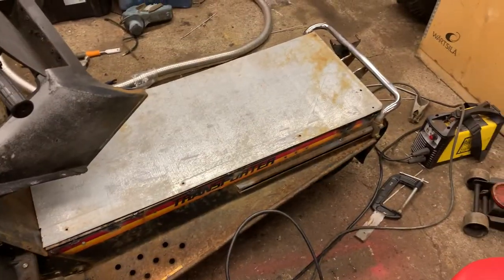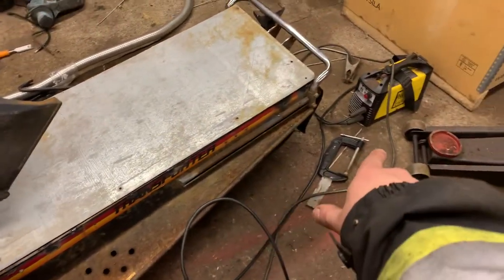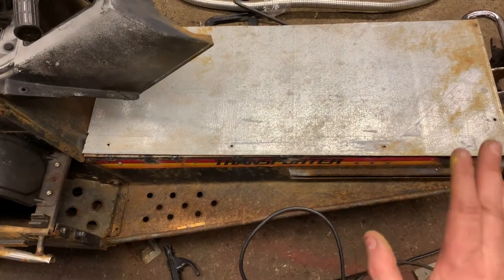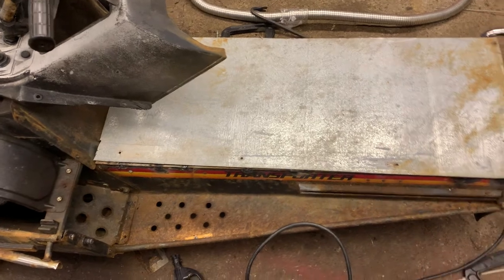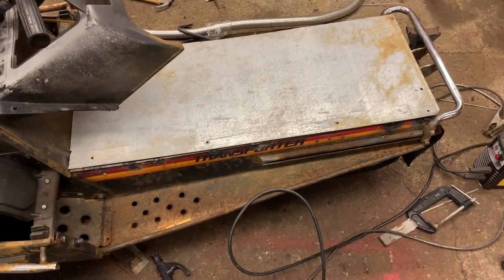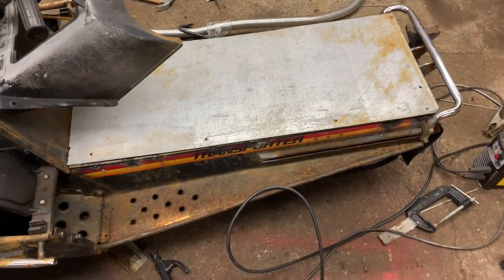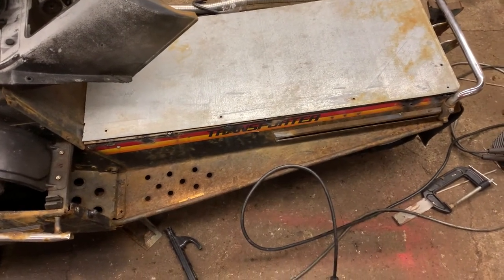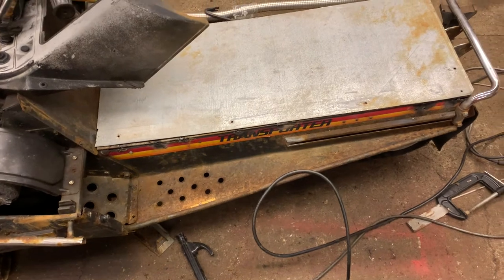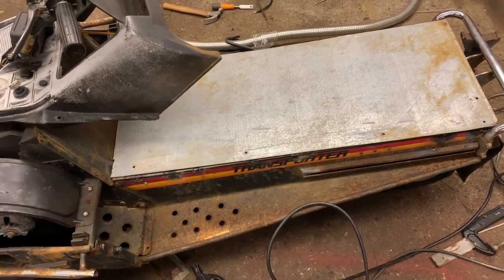Hey guys, I'm still out here in the shed — pretty much going to call it up tonight. I got some bracing underneath with a nice bit of flat bar welded in with that little stick welder, so she's all nice and tight underneath. This is a nice heavier gauge galvanized metal that's now laid in place — it's roughly the same size as the metal I cut out. This is just some scrap galvanized sheet metal I had kicking around. That's the first rough cut — I've got to clean everything up, but this is now going to get riveted in place. We got the structure underneath with the flat bar so we should be good to go — this is going to be better than what was there, a bit more sturdy. Tomorrow I'll crack on with some riveting and get the sheet metal down in place.